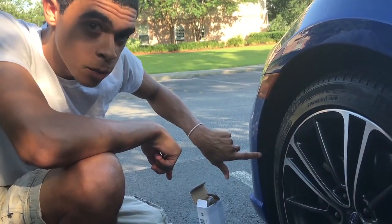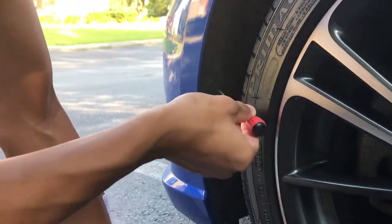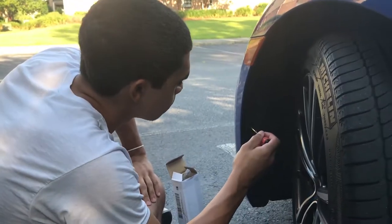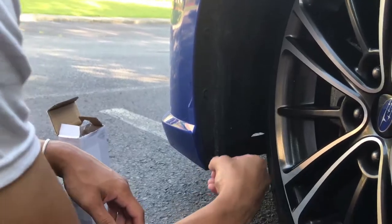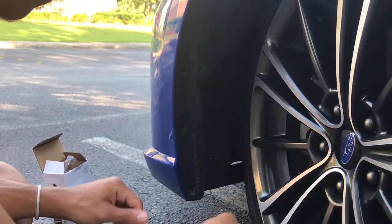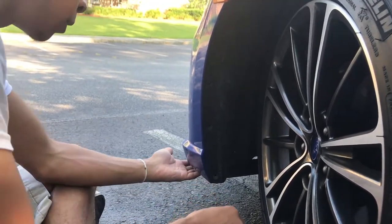Right here you've got one, two, three of these Phillips head lock washer type lock nuts. Turn the wheel and get these out. Sometimes if you have a lot of dirt in there it can be hard to get them out. Once you unscrew the Phillips, pop them out — don't lose them. For the fender lining you will get some dirt on here, and there are two clips underneath.